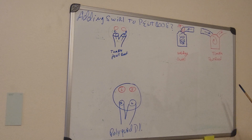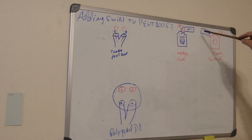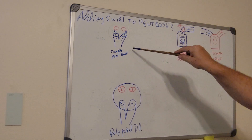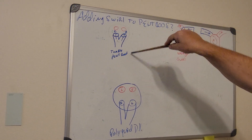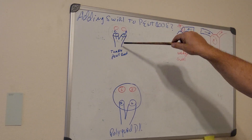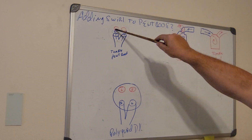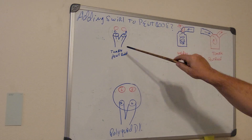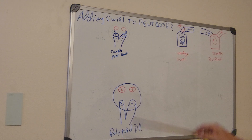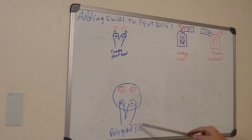So we know we have tumble and swirl. This is a standard tumble pent roof — looking from the top down, we have two equally-sized runners: the intakes are going to be the same size and the exhausts are going to be the same size. You get about the same amount of flow on each side, so all you're going to get is your tumble.